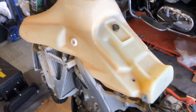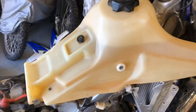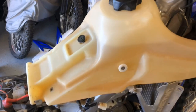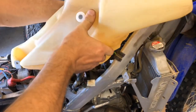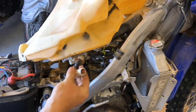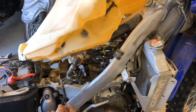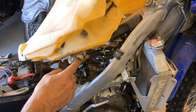Since this is a fuel injected bike it's got a fuel pump, and on this one it is built into the tank. I've already had this up and taken a look at it. There are two bolts up front, one on each side, that have to come out. You lift it up and then gently turn it to the left side — looking from the back — and underneath here's the fuel pump. There's a white plug that goes straight up underneath, and then a black plug right there — that's probably your fuel level sender. And here's your fuel line that you have to remove.